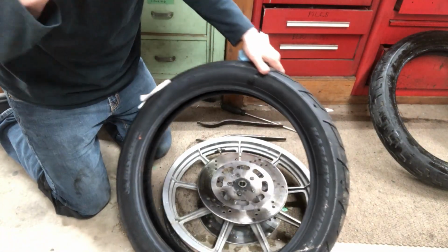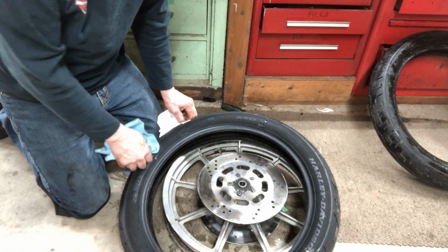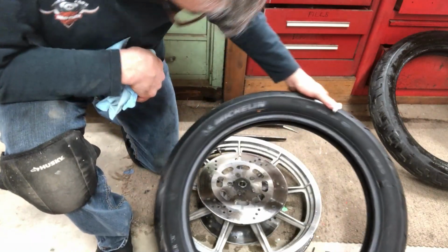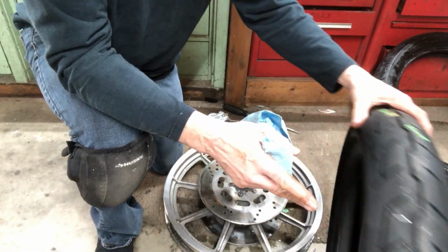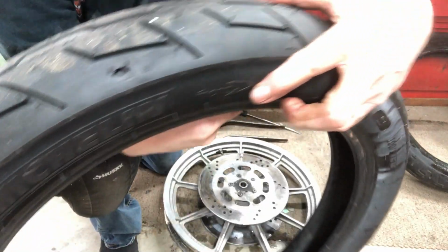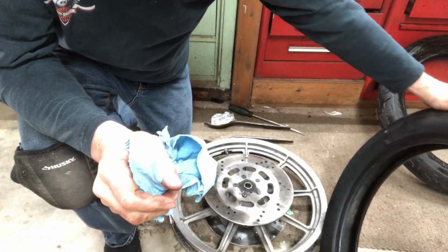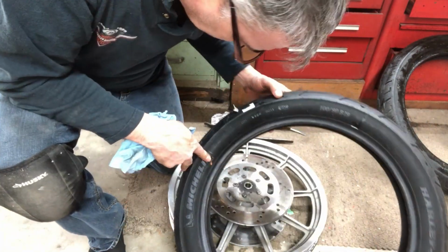These tires are directional. Some tires you can use for front or rear wheel, and they'll have a direction for both directions, the same tire. And then other tires are just meant to be fronts, and sometimes you can tell by the pattern, but often they'll have an arrow. There's an arrow right there, front. You can see that right there. And then the other thing to look for is the yellow paint dot. In this case it's orange right there.